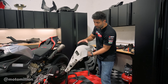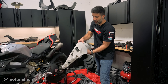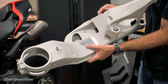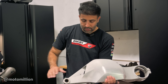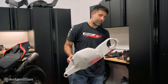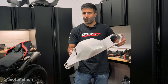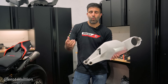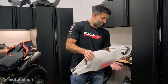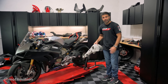Then we were going to cover most of it with our carbon fiber swingarm cover from Full Six and let some of that brushed aluminum poke through. I'll show you some test pieces — you can see there are no more pores left here. The tricky part is this is a lot of work to polish the whole thing given how many crevices there are; some of it gets covered by our chain guides. I'm going to send this to my good friend Aaron, who has a big tumbler — a big barrel that shakes this with media inside, like walnut shells — that will polish it down. Is the juice worth the squeeze? Let us know. I think it would look really cool but I don't want it to overpower the look of the bike. We're still undecided — maybe we'll save it for another build.